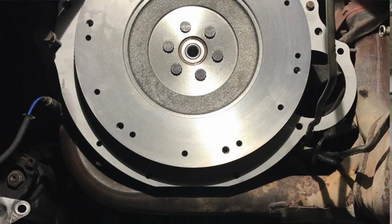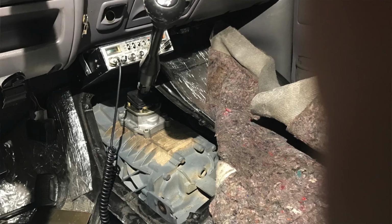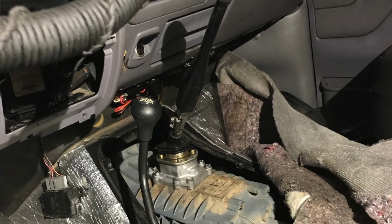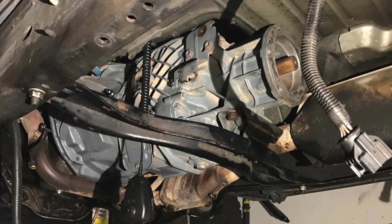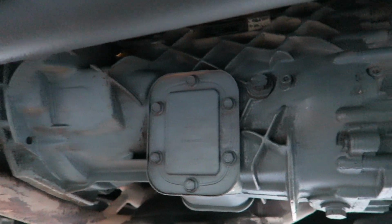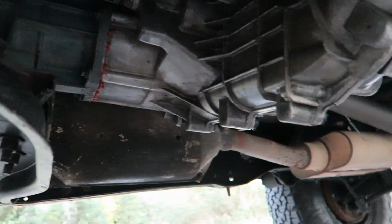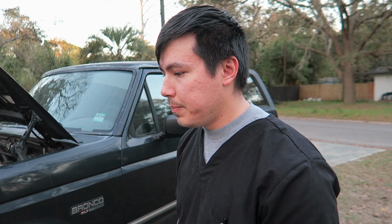All I had to do was get the clutch, flywheel, and pressure plate and all that stuff for an F250 and just mate it to this motor and transmission. The ZF5 is great because it has a granny low first gear. Normally you only use 2 to 5, 5 being the overdrive. And I also swapped in a manual transfer case from an old body style Ford.